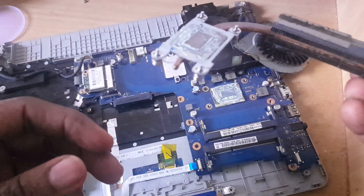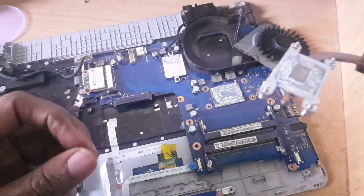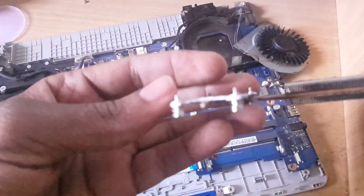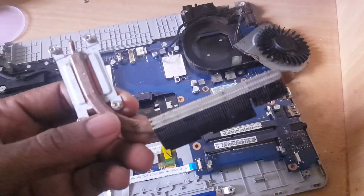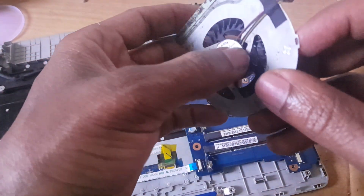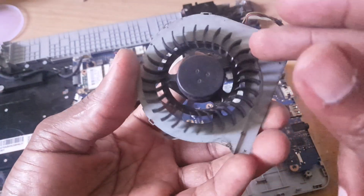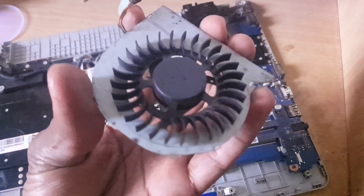What you do next is go to any store that sells electronics and buy thermal paste, then put it back here on your processor so that it can synchronize very well with your heat sink to cool your processor. Make sure you have cleaned it very well with no water. I'm going to leave mine to dry, then after you fix them back you'll be good to go. The noise — the way you can stop it at times — you need to slightly open here and put a little bit of oil if it is getting stuck. If your fan doesn't spin even when you blow it, it means it has a problem and it will keep overheating.